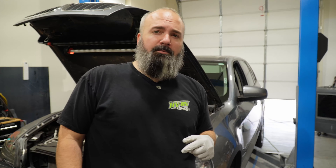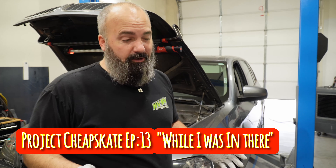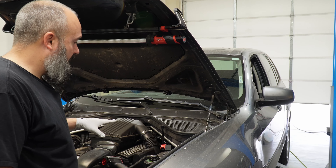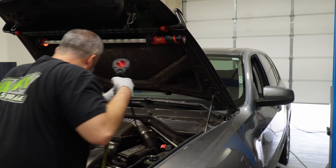If you're new around here, I'm Jason. This is Project Cheapskate. Out here in the shop, I try to accomplish as many small projects, big projects, and every project in between as I can in a way that might help you do it at home. We're going to get started by unbolting the top of our motor mounts. We've got an 18 millimeter up here that we can get to pretty easily with a long extension.